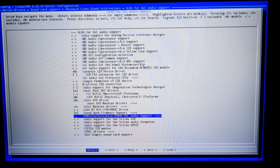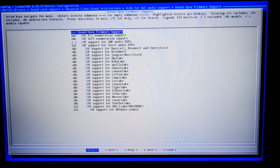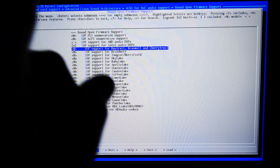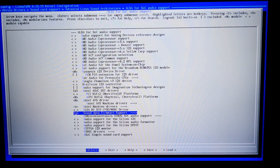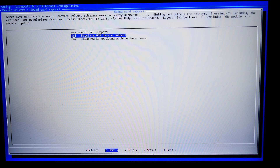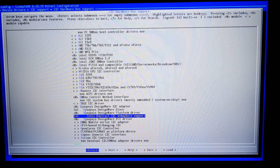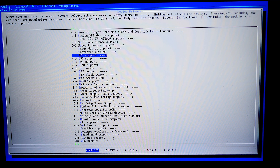What I actually needed was the Sound Open Firmware driver — SOF for Intel audio DSPs on Bay Trail. I hit module on everything because I'm lazy. I also punched in the Synopsys I2S driver. You know why? Because to get the touchpad working, I had to select the Synopsys DesignWare I2C adapter — that's required for the touchpad. You have to have that specific one with platform semaphore support. There's no way I would have known that without a lot of digging.